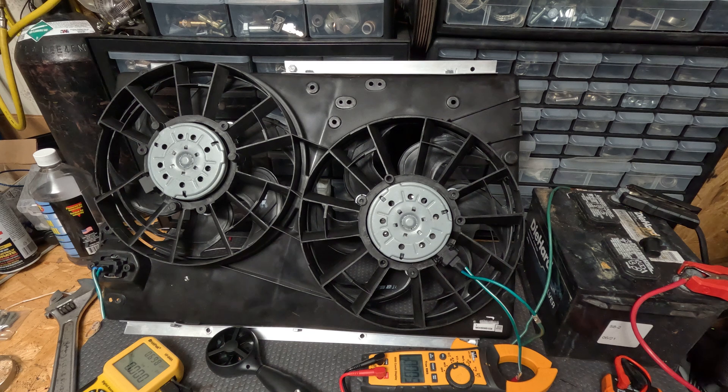These fans for the money are really going to be hard to beat. I tested some of the others — the thin fans just don't do it at all. They rate them well but the motors are so small they drop off so fast. It's just not worth using them unless you possibly have a thin stock radiator, or you're using them on just a condenser or something really thin like a transmission cooler.